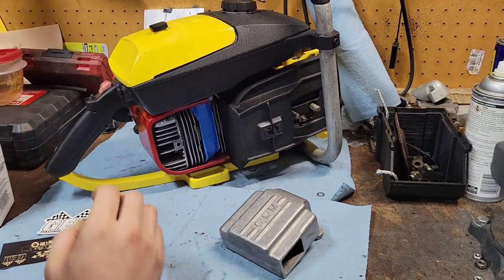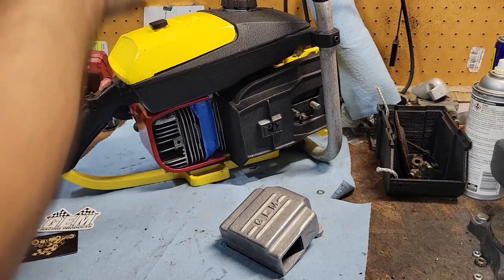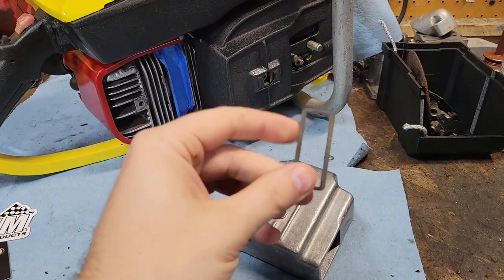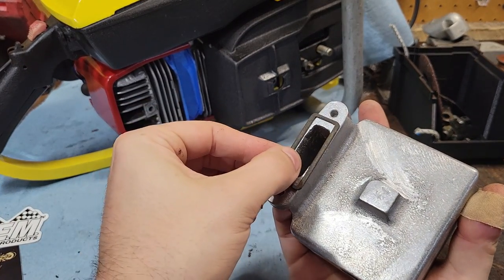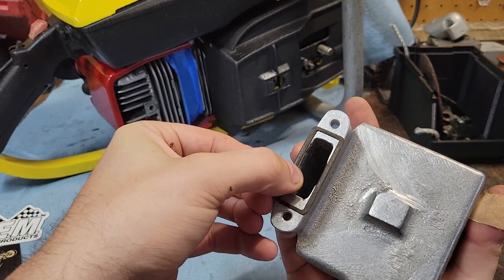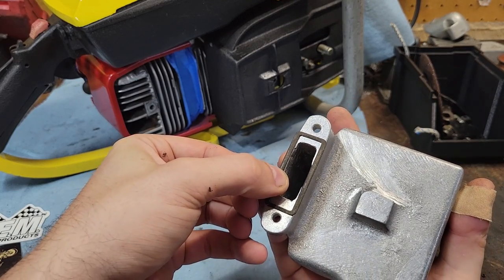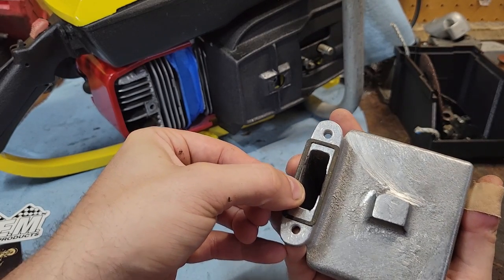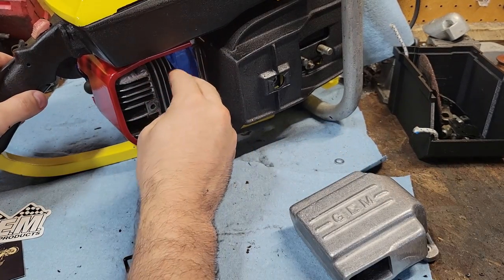Now, that gasket I was telling you about a while back, maybe during the video, this is a 101B gasket. All right, let me get you zoomed in here, because we're going to need to. So, this is your exhaust gasket. See how much you can really open this up. This is how tiny this is compared to your actual port. So I may try to take a grinder to this in the future. We'll see. It may add just a little bit of back pressure, but that is how much you've got top and bottom that you can open this up. If I recall correctly, it might not be that much.